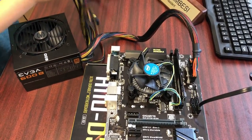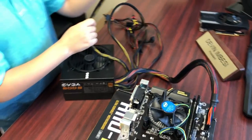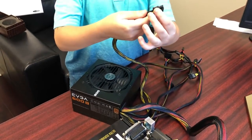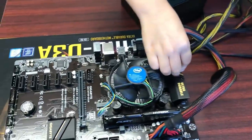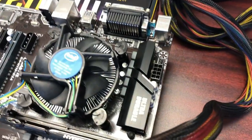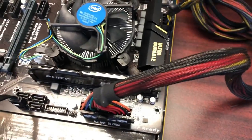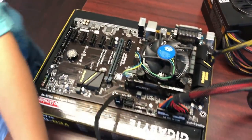If you don't want to burn out your motherboard, you also need additional power for the CPU. This is an 8-pin connector — it may come separated. These ones don't have a slide latch; you just push them in and wait for the snap.